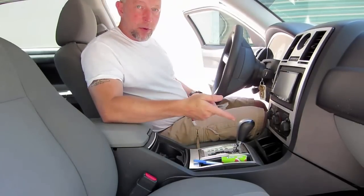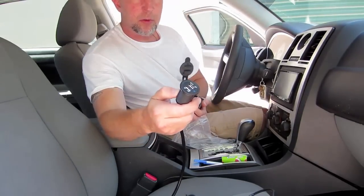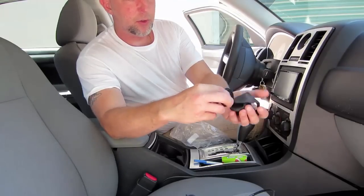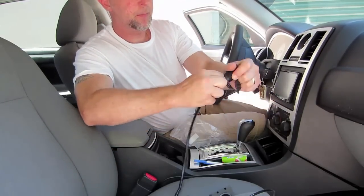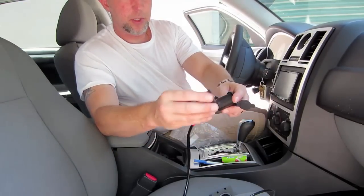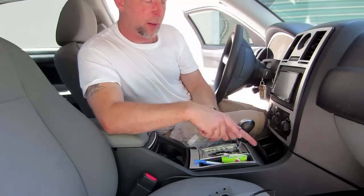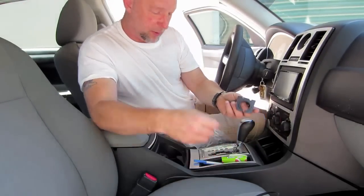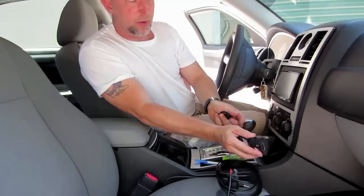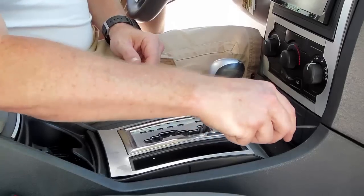I'm going to show you how you can remove your old cigarette lighter and replace it with your new improved USB plug. With these new adapters it's going to retrofit your cigarette lighter jack. There are a couple of different ways to install these — one, you just put it in from the front and sandwich it in with this little piece, squeeze it right onto the dash, which is how I'm going to install mine. Or if you want to keep your cigarette lighter plug for whatever reason, you can get an extension and mount it underneath the dash.